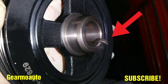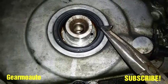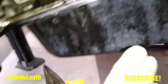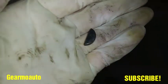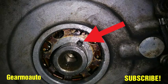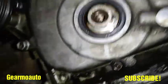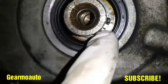I also got a new crankshaft key. The crankshaft key sits in a little slot — you can pull the old one out with needle nose pliers. I kind of recommend not doing this if you can avoid it, because it can be a real pain to get back in. The problem is there are two gears that shift when you take it out, and you have to line those two gears back up to get it to go in properly. It just took me a while.